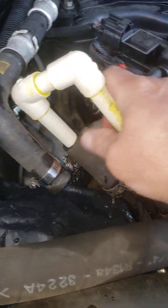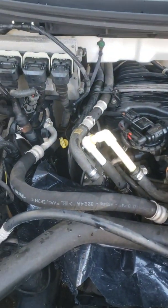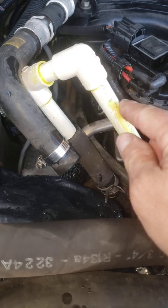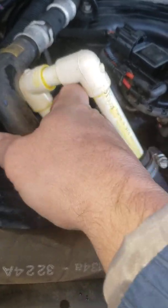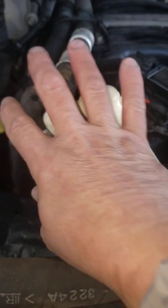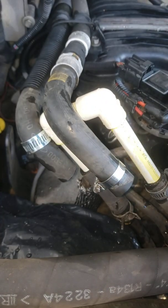You can bypass it right there — no problem. And if you want, you can cut this off, buy the same CPVC, glue a half-inch cap, put it right there and cap it. If you want to reuse it for the future, you can do that too — that's why I wanted to do it this way.